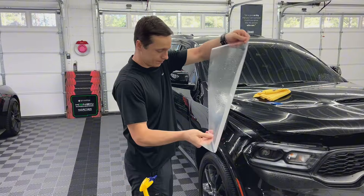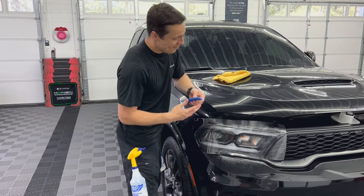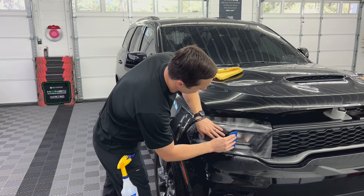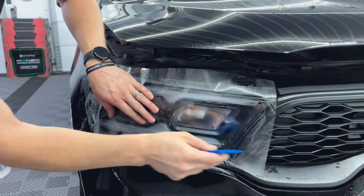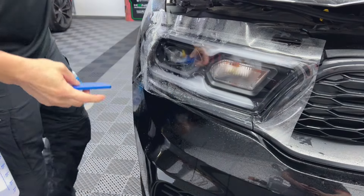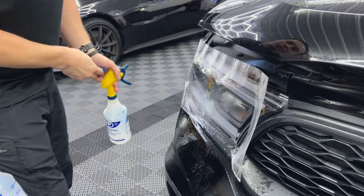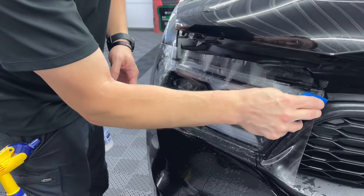Don't need a lot of slip solution — I'm going to slap it on. Spray the surface so the squeegee can slide, let's put it in place and get all the moisture and water out. I want it to go ahead and tack — I ain't got time to be waiting. Rinse all that slip solution out with just plain tap water and see how it just locks down.